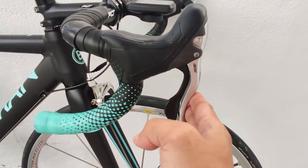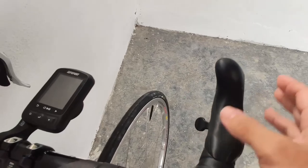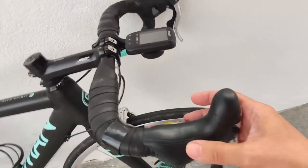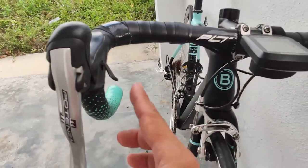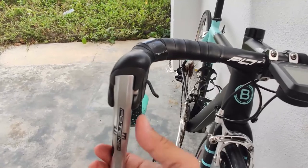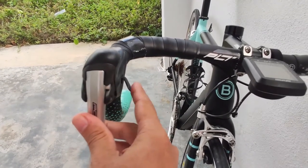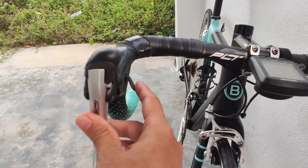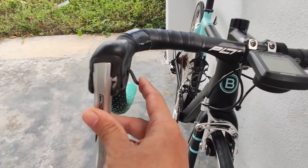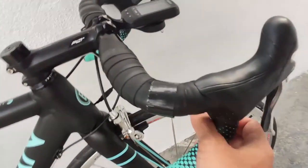I like the organic shape here, which allows you to grip at the bottom or at the top. One major difference between this Potenza hood and the earlier Super Record 11 and Chorus 11 groupsets is that the downshift lever is bent down, similar to the EPS groupsets, and it only shifts one cog at a time. It does not allow you to shift two or three cogs like what you find in the Super Record groupsets, but I actually prefer the shape and design of this particular lever.